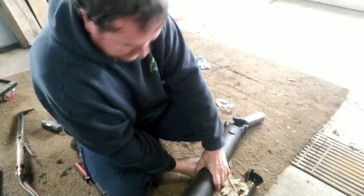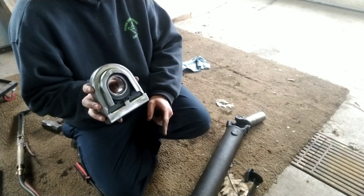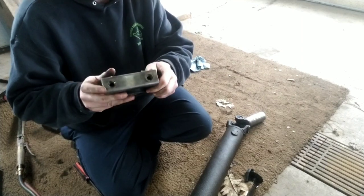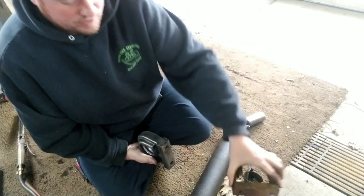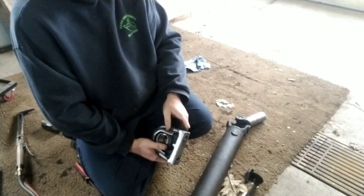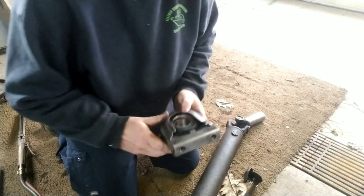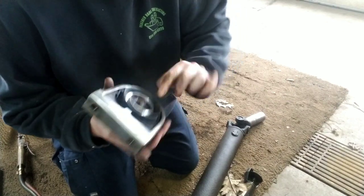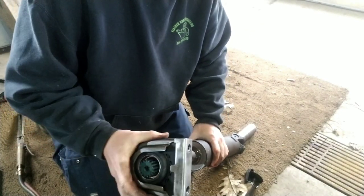The shield's on there now. If you're doing a second gen Cummins with the smaller bearing, the mounting tabs come out the side. This is the bigger bearing so they mount up top — and of course the old ones broke off. Everything breaks, even getting the bolts out of the rear of the drive shaft. This front side goes into the transmission, and the little hood part goes toward the rear end.